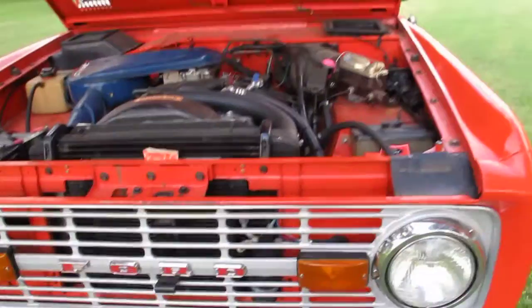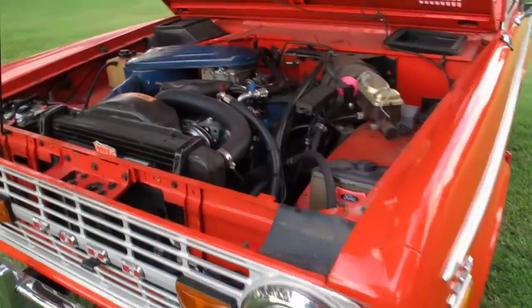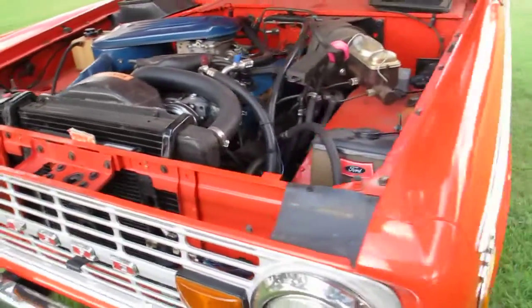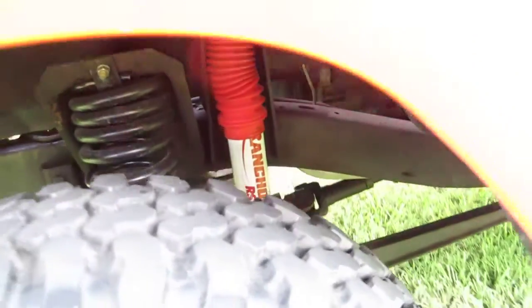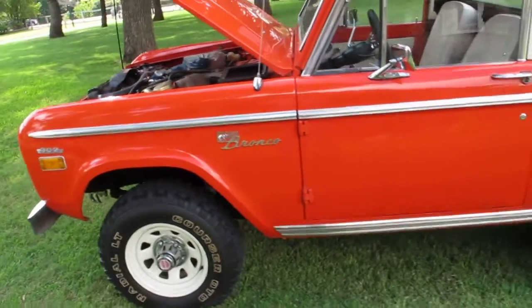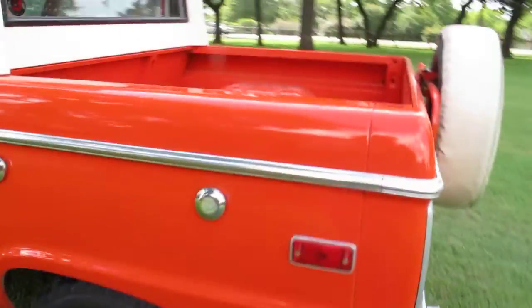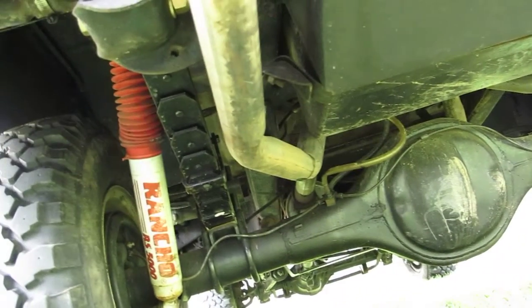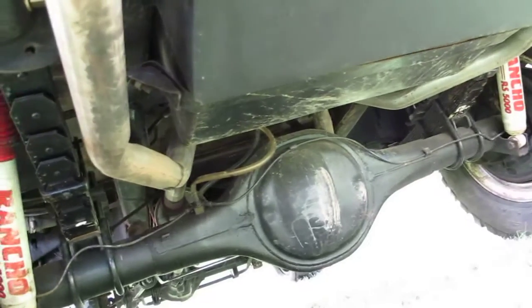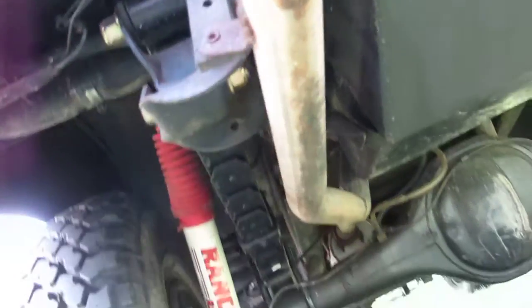It also has sway bars front and rear. You off-road guys know the sway bars don't help it articulate, but they do make it drive nice and flat going down the highway. The springs are Deaver, which give it a good ride quality, and it's got Rancho shocks. If you wanted it to flex more you could remove the factory sway bars. Also with the '76 drivetrain you get the nine-inch rear end with a larger housing — it's got gussets that go all the way to the middle of the tube, whereas on the earlier Broncos those gussets end right there at the pumpkin. It's also got Deaver springs in the back.